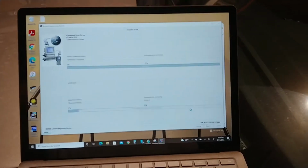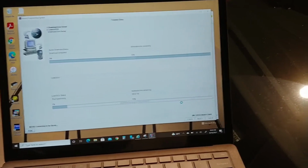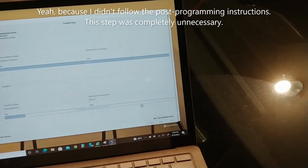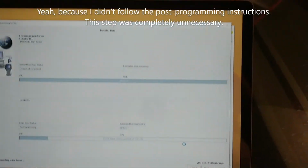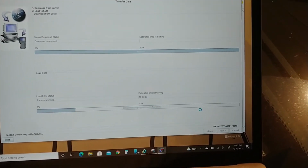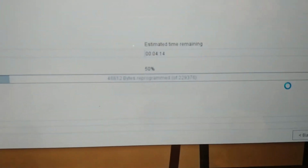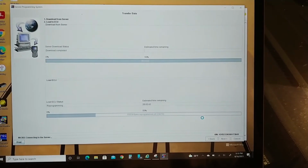Okay, so here's where we're at. I have some code for checksum failure in the amplifier, but I do have communications with it, and I just did an audio test on the speakers, and I heard tones, but I don't have turn signals to radio, just like before. So I am trying to replace and reprogram rather than just reprogram. Perhaps it'll do something different and reinitialize it. Kind of weird to have a checksum error, but maybe all of this reprogramming did brick it, but we're going to try this again and see what it does, since now I feel like I can flash successfully at least.